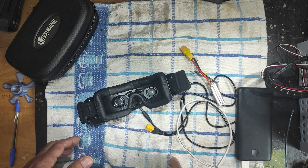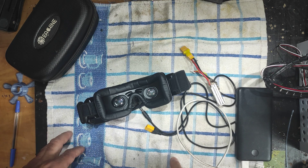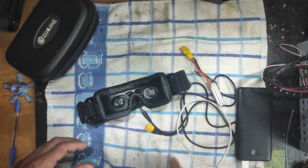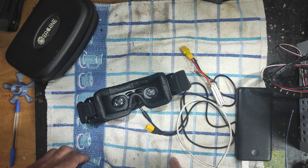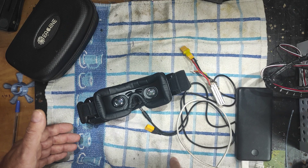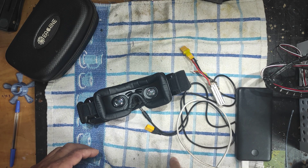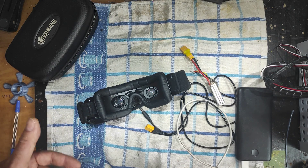The brightness of the screens is very dim. One of the screens looks like it's working at low brightness, and the other screen is just white — a pale, dim white. It doesn't have a signal from where it should; it's just the backlight, it doesn't work.